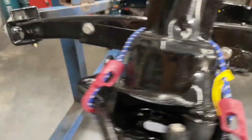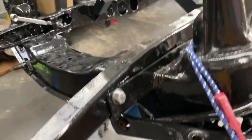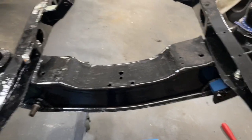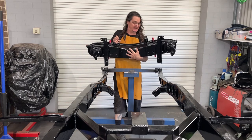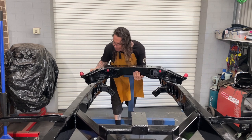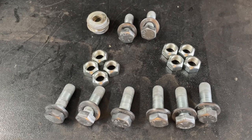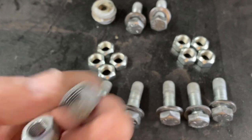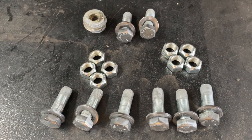I've got one side in there, but I think what the problem is, is I can't swing the hammer past this horn. So I'm going to have to take this front end out again and try and put the control arms on on the bench. Let's put this front end in — straight in, no problem. Now that I'm bolting this front end in for the final time, I'm going to use some self-locking nuts instead of the standard ones. So I've prepped up all these bolts and it's time to put them in.